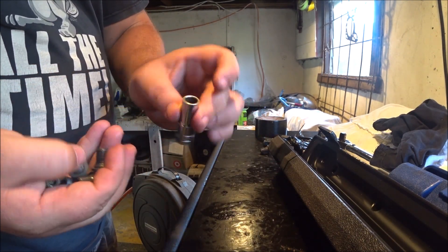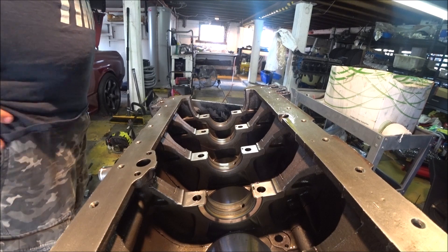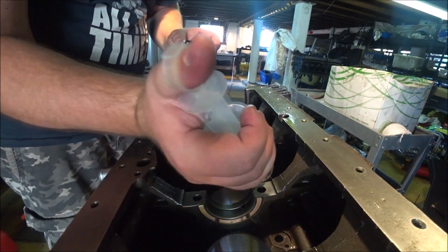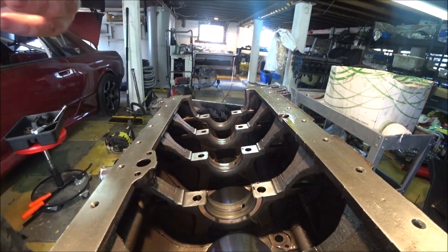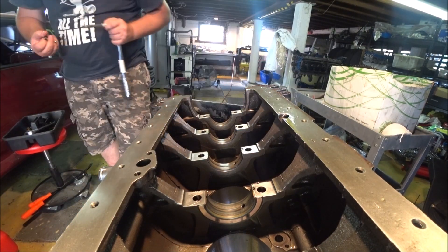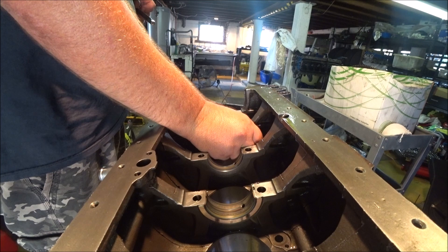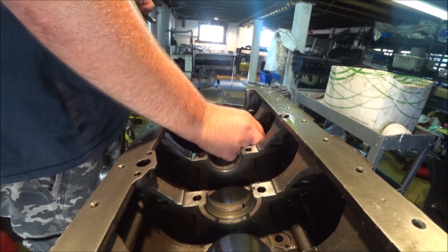These are a 10mm multi-point. Just get a bit of oil — just make sure the threads are wet. These go in. We need to get some oil in the passage itself. This is my main oil feed passage. This is the squirter and here's the bolt — it aligns with the hole. There's a little dowel for the squirter; make sure they're lined up.